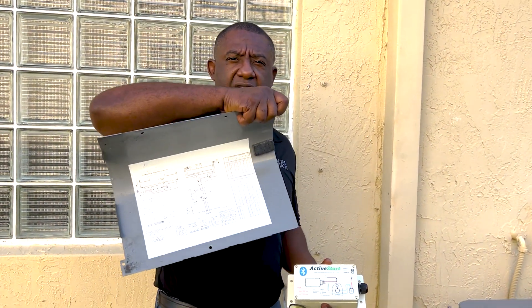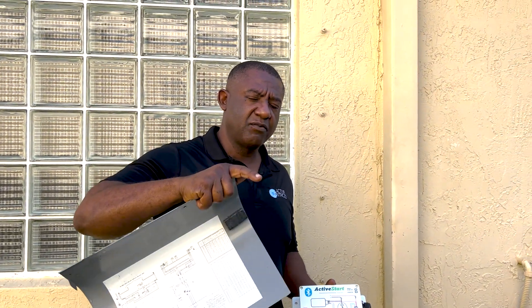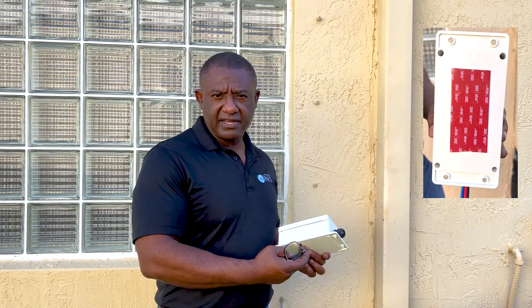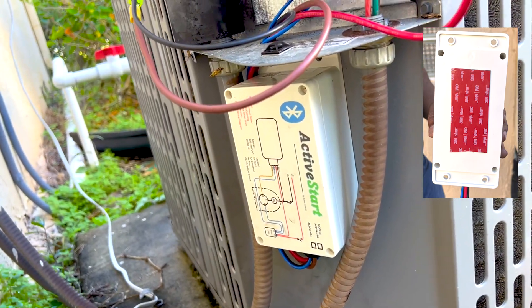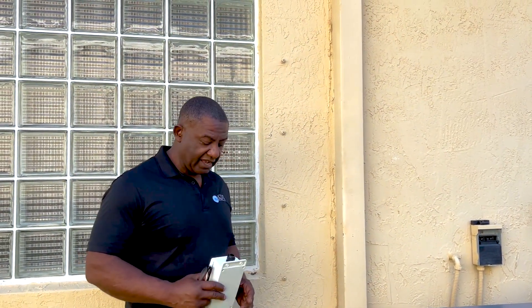As in my previous video, it's very important that you follow the wiring diagram of your unit, paying attention to the start winding, the run winding, and the power. Our units come with sheet metal screws so you can screw it on, but we also include double-sided tape, which I'm using here — it's just stuck to the unit because I take my unit on and off so often for testing and evaluation. It's holding very nicely. Again, pay attention that the wires are down, not up.